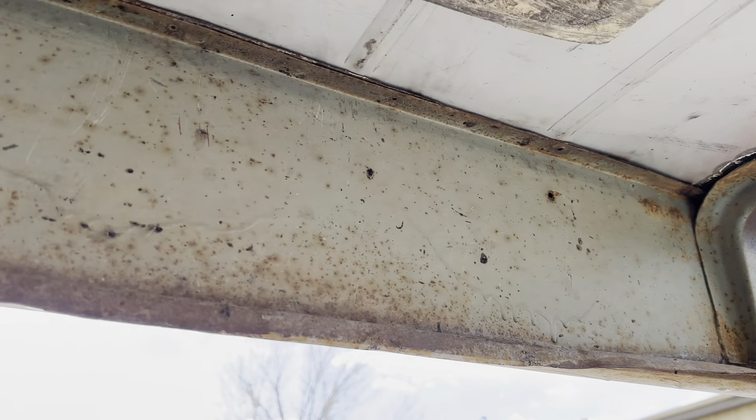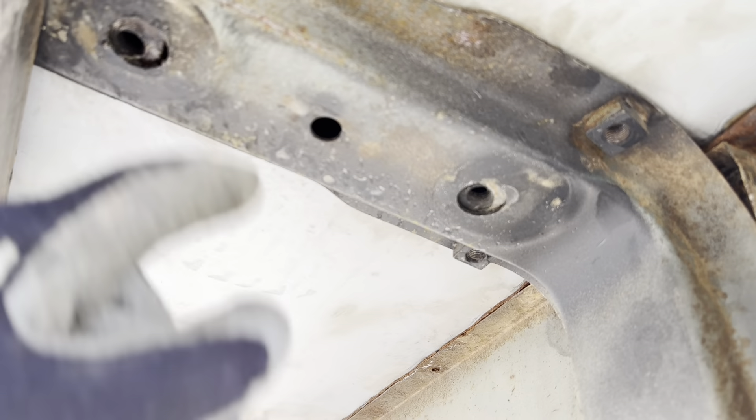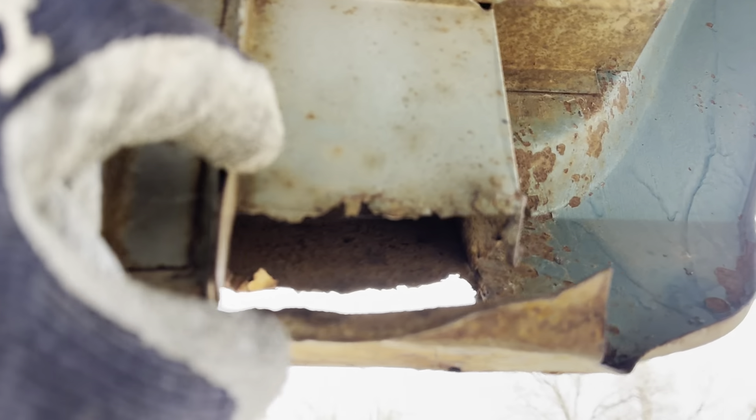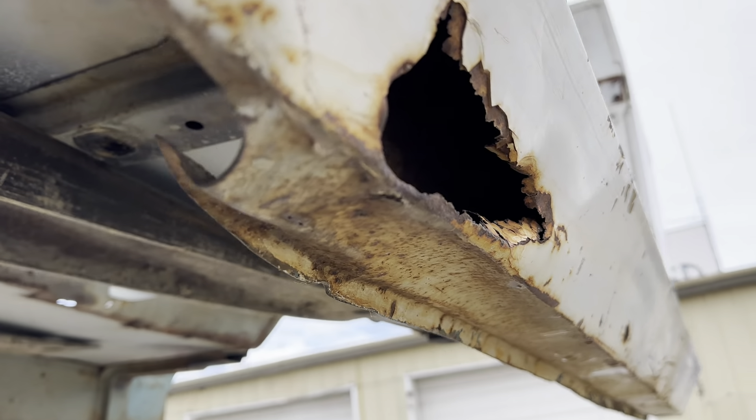There's your side skirts here — these are all in great shape. There's a little bit of surface rust, but no holes or anything through here. The seams look real good. Torque pocket excellent shape there. Coming over to your passenger side again — clean. All the way up to the front. Right here, the box area started blowing out there, so that needs to be repaired. And then again, your side right there. So that's really the extent of the damage that needs to be fixed on this tub.